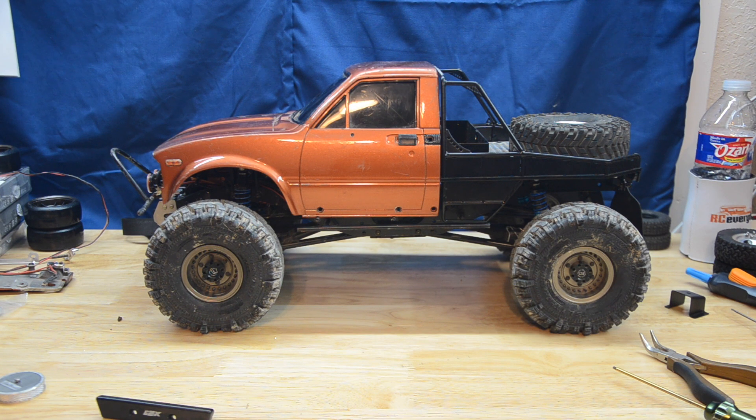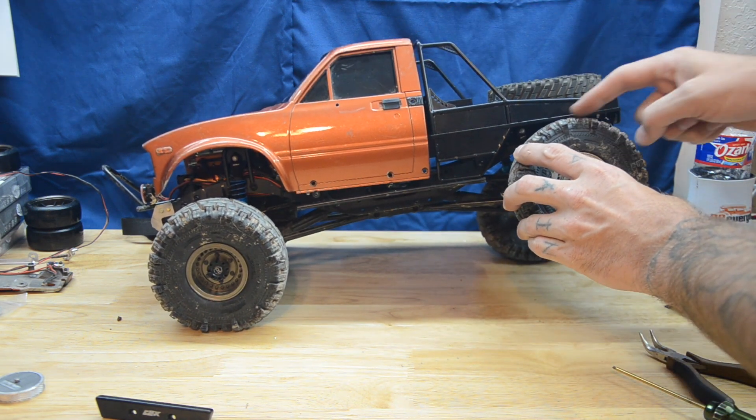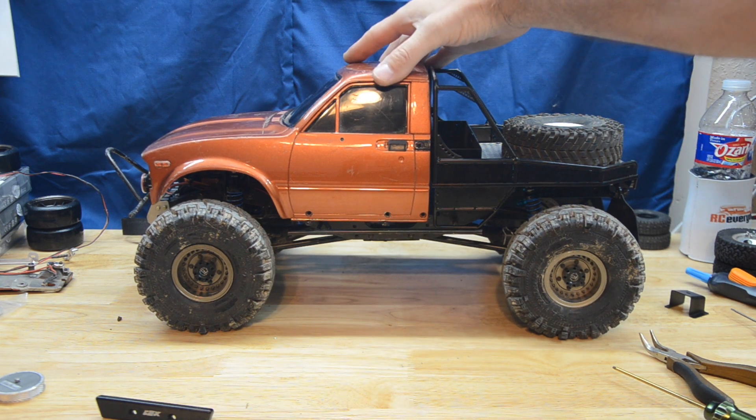It sets up a little bit higher in the back. Right now I'm kind of stuck — I can't put the body down all the way because I haven't cut a hole for the engine yet, so I'm going to wait for the cab to get here before we move on. I'm even thinking about a dovetail in the front — I've never done one before so it might be fun, and it'll actually fit this build pretty well. The back works out perfect right now; under full lift it does not touch — it's just right there at the bed. But I need it to set lower at ride height. Right now the cab's sitting on top of the body mounts.